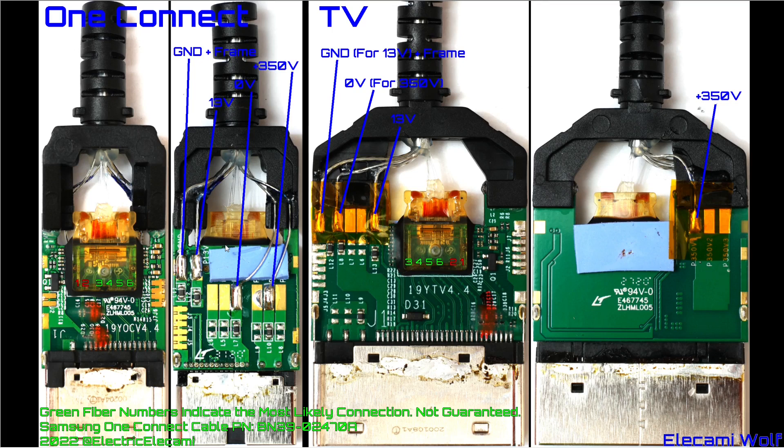You can't shine lights into the fiber without it being cut, or the other way is by enabling the transmitters and receivers, which is not easy to do outside of connecting it to the TV — and then they all turn on at once. So I've identified the four power conductors that go through the cable, and that's labeled there. There is the high voltage, which at the TV end is on the bottom — it actually says P350, meaning 350 volts. The other labels are under that pad, which I didn't remove because those wires are glued down and they seem to have quite thin, delicate insulation on them. Similarly, the 13 volts and ground are there.